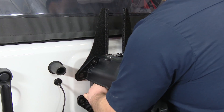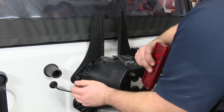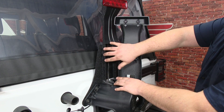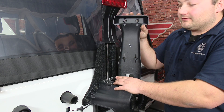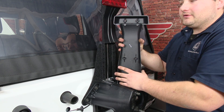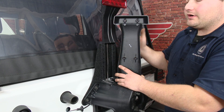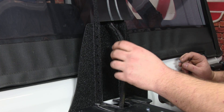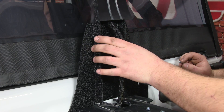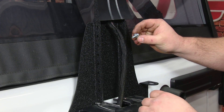Run the wire through the spare tire mount. As you'll notice, this new extension is already at its lowest adjusting point and it's a couple inches higher than the factory light. As a result, the wire for the third brake light is not long enough, so you will need to extend the wire just a little bit to make it work. Once you extend the harness to your liking, you can mount the extension where you would like. In our case, we're going to use the lowest setting, and now we're going to install the provided hardware.